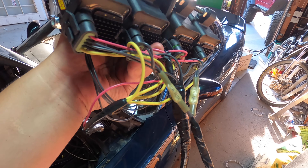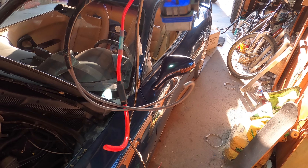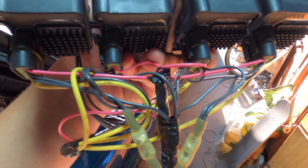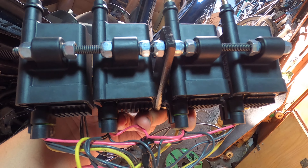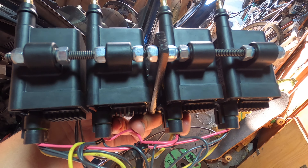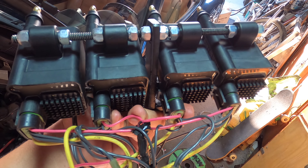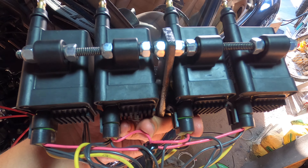Here are the coils with the wiring harness. Overall, it came out pretty good. It actually came out a little tighter than I anticipated — cut it a little too short — but overall I was able to fit it. I've got the two leading coils on the edge since they fire more frequently than the trailing coils, and the two trailing coils in the middle. I think that'll help a little bit with heat management as there's a higher duty cycle on the leading coils.